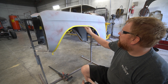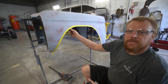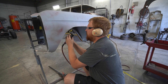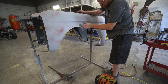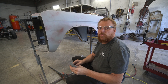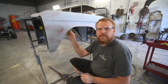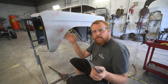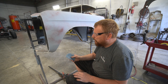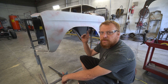Now we're going to take a roll-lock disc on a little grinder — this is 36-grit — and just clean this area up a little bit, get it even more rounded out, and then come back and sand that edge, put some primer on it, and it should be about ready to go. Take some 180-grit and knock this edge down from where our grinder and saw blade sometimes leave a little bit of a sharp edge. Basically just rubbing your hand over it to check — you might have a kid grab it and cut themselves, so just something to think about.